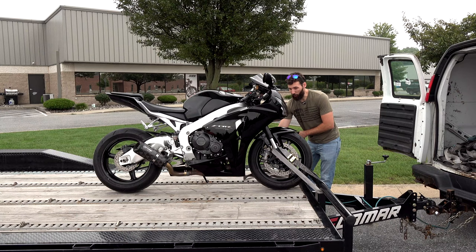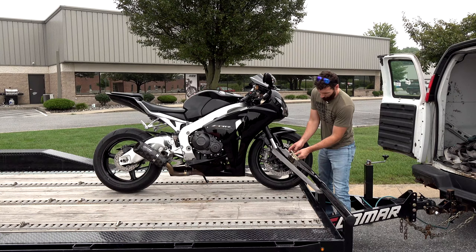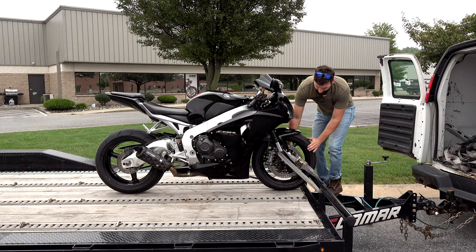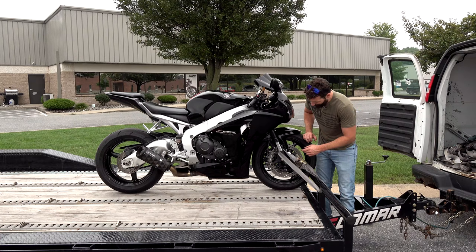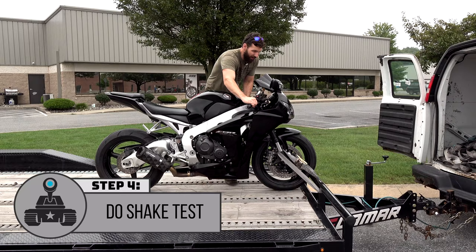If you do the kickstand side first, leave a little bit of slack for you to pull it on the other side. If you do the other side first, just don't crank it down so hard that it's going to fall over on you. Now I've used these straps for transporting my van, my Expedition, my Dodge Viper, the Austin Healey on trailers — these are very heavy-duty straps, more than enough to transport a 400-pound to 1,200-pound motorcycle. You see it starts to compress the tire a little bit. On sport bikes sometimes it's going to push out on the little fender, but it's fine — it's not rubbing because it's not moving. Shake the bike — the bike's not going anywhere. I couldn't get this bike off without releasing the straps.